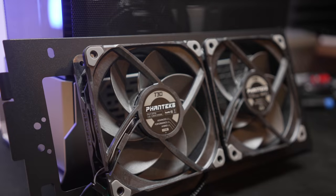Overall, this was a fun case test since it can be configured in three ways. Let's talk about thermal performance between the three modes — as you might imagine, the three configurations have varying degrees of performance. For the air cool test I ran the cooler fan at 100% since we're simulating a higher load, though for gaming you probably don't need to run it that hard. It's actually a very quiet fan with the cooler I set it up with. The T30s as case fans are running at about 1200 RPM and are also very quiet at that level. When used as rad fans, I set them to 1525 RPM to match the noise levels of the other cases we're comparing against today.